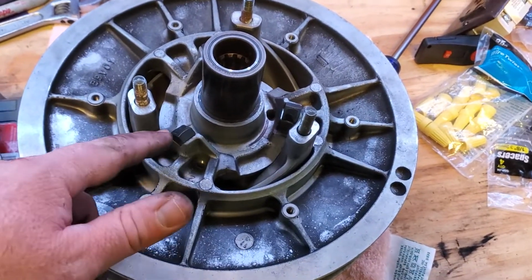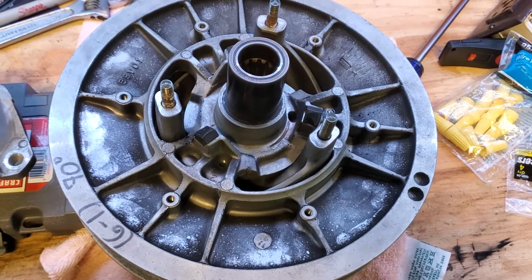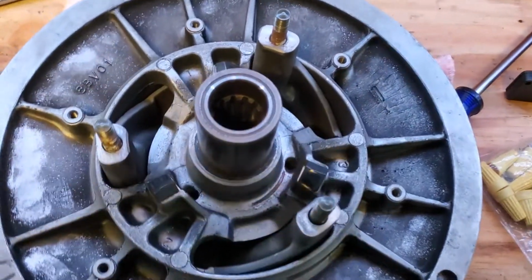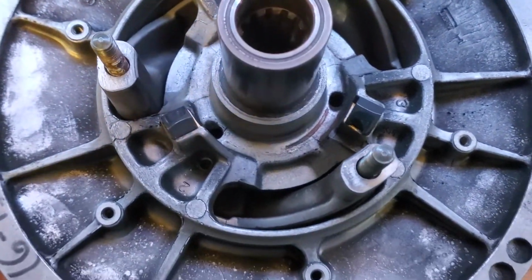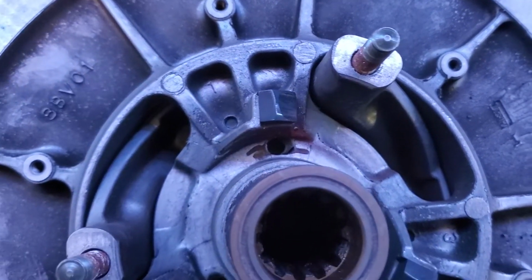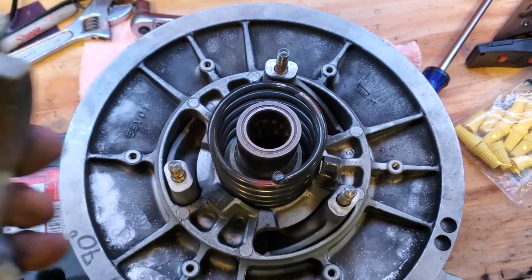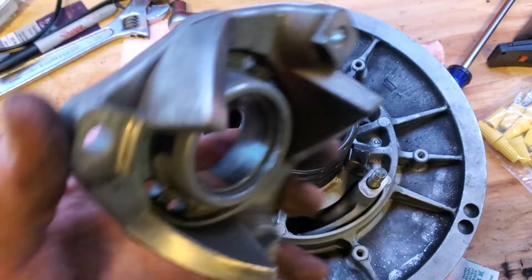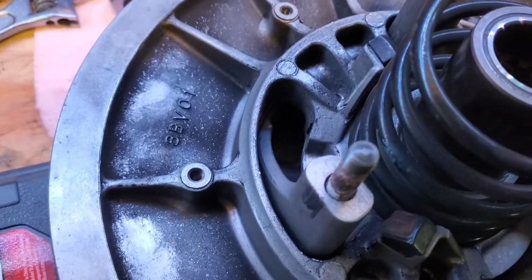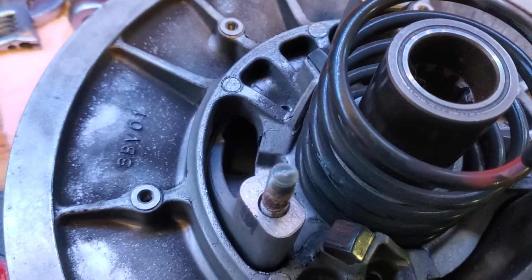So I've got the new little plastic pieces on order to get those replaced. We'll pick those up at the first of the week. Then we'll go ahead and put this all back together for now. So you got to remember where you had your original hole right here for the spring. Make sure you get that back in position. And then you'll take the top piece here that you took off first, and we've got the marks that we made right here. So we'll get that close to that side, and then we'll twist it into position.